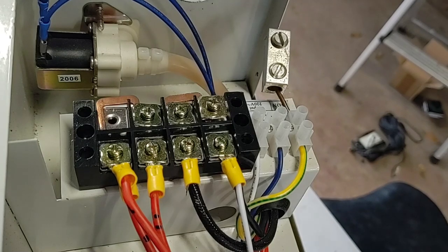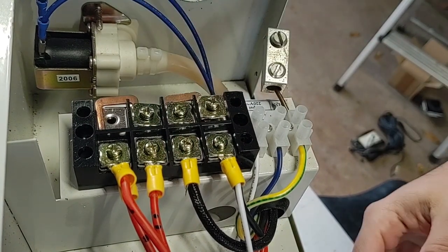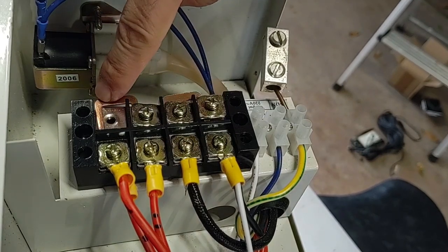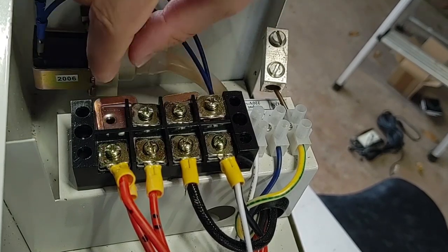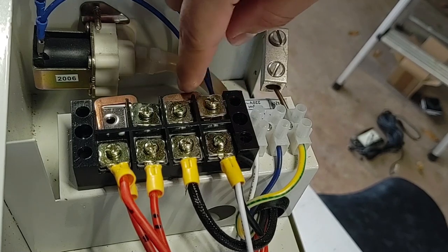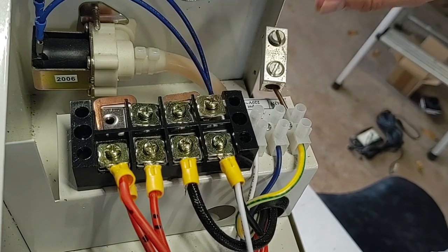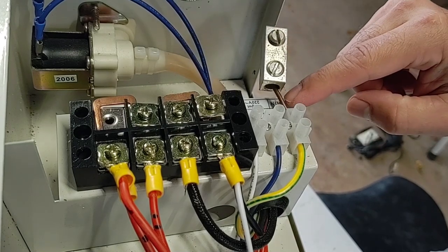In this section, you have the solenoid valve — that's what lets water in and out, and it's measured. You hear every time the tank starts running low, it'll kick on to allow water in, and once it's full, it turns off. Your wires are coming through this hole here. You have a jumper here and a jumper here. You put one hot wire here and one hot wire here — these jumpers give energy to the middle sections. Your ground wire has to go into this section. The eight gauge ground wire feels way too large for this tiny port, so my electrician used a connector to join two ground wires together so you can use a smaller ground wire to fit in there.